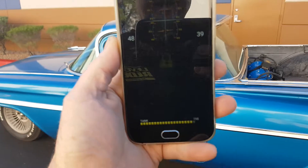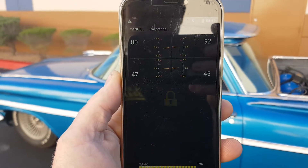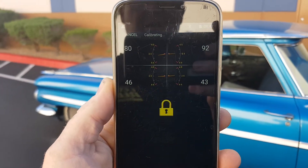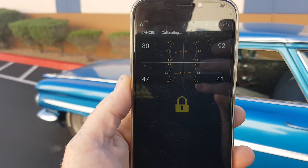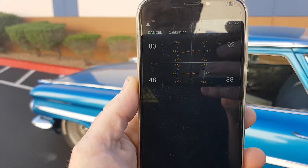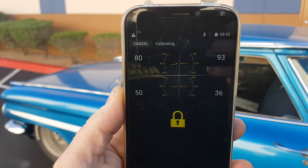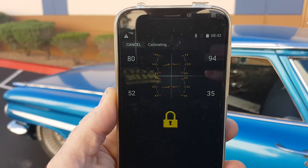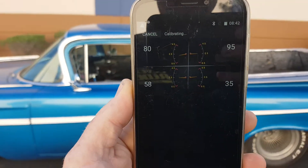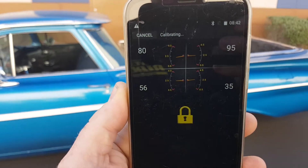The tank's caught up again — we're at almost 200 PSI. It's getting to the point where it's up around 55–60% of its height. At the moment it's just adjusting the front left and the right rear. It's now bringing the car back up again in small increments because, as I said, it's calculating the corner load.